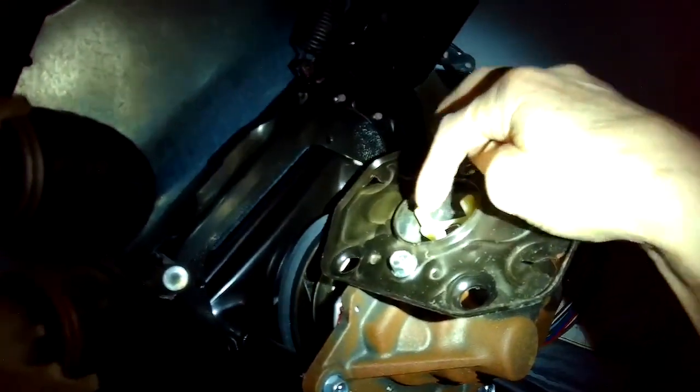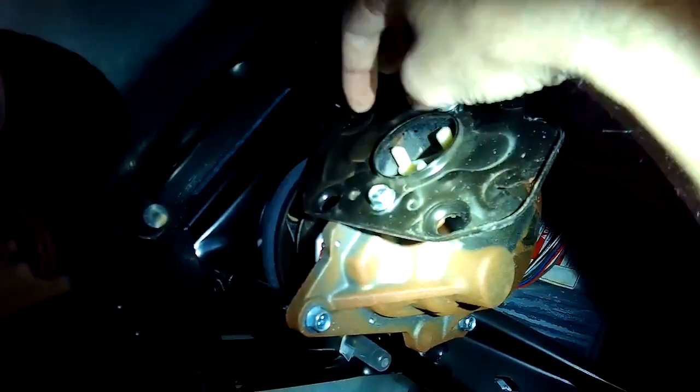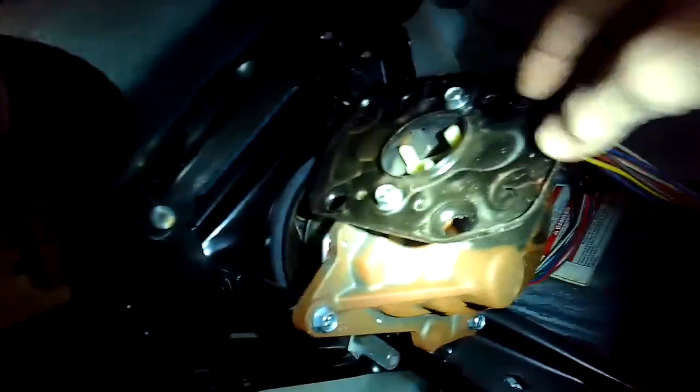So we're going to get this ready. I'm going to take these guys off of the motor, the transmission motor plate, put them on those stems to get that ready. And this part, we're going to get this ready. So I'm aligning the transmission one. So this is at 12 o'clock and this is at 8 o'clock, 4 o'clock to match the one on the motor. So I'm going to put the motor on there, and then that motor mount, the rubber piece, is gonna fit on these forks, and those rubber feet on the motor are gonna fit in these holes.